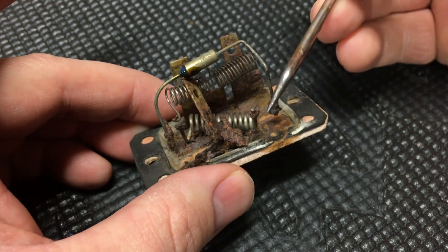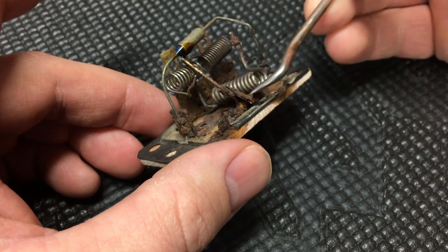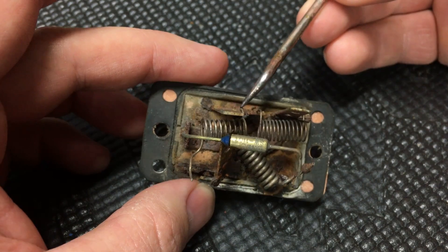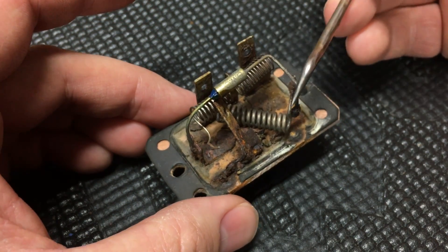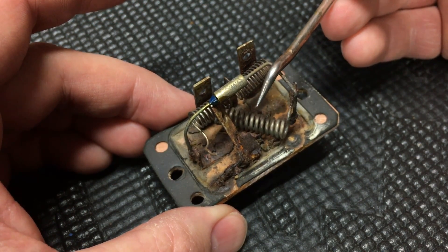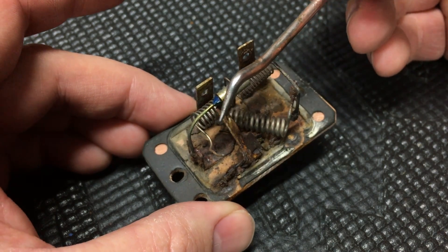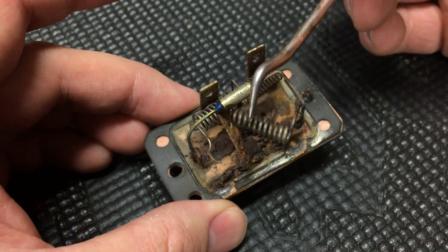As you can see here, this is the same blower motor resistor but it's about 14 years old, and you can see how the thing literally just falls apart after a while. The most common symptom associated with this kind of corrosion is that your blower motor will work but only on high. The reason is that all the other speeds — medium high, medium low, and low — all go through here as the voltage gets stepped down.